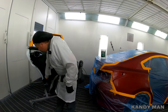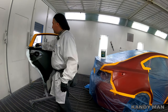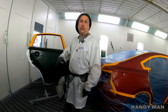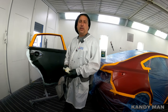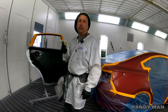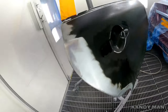You'll see it actually changes the look of the metal. I used this earlier this week and it worked out nicely. It's especially useful if you strip a roof down to bare metal and don't want to etch and seal separately. A lot of times I'll get a roof job that's delaminated with no filler — I'll strip it to bare metal, seal it, and go right into base and clear without priming or sanding again. Hit it with this or epoxy prime and you're good — if not using epoxy, use this and go into your sealer.